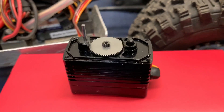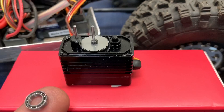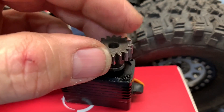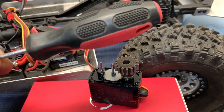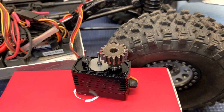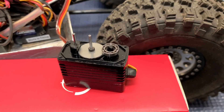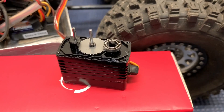Putting the new gears in place, you've got to put that first gear down there and then the pin. The kit comes with new pins, so I am swapping both of those out. Up next is the bearing to go right over there. Getting the bearing in place takes a little bit of patience — it fits on there pretty darn tight. What I did was use a pinion gear with a five millimeter bore, then just a screwdriver and tapped it around to work it all the way down. You don't want to take pliers and get on the outside edges to crank this down because you could bust the balls, the races, or the internal cage which holds the balls in place. You don't want to do that because you'll just ruin the bearing. So take your time.